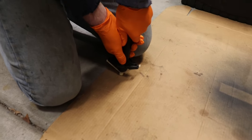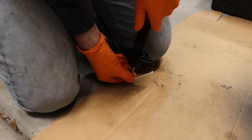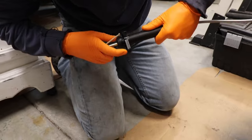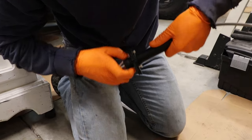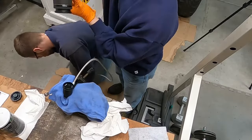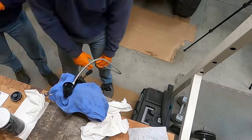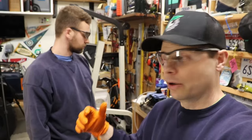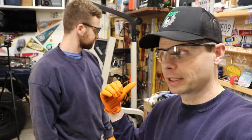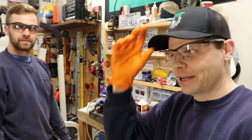So now that we're done, he's gonna go ahead and push that in and clip those nylon straps back on — just like that. This method of bleeding the clutch master cylinder — bench bleeding it — is called reverse bleeding. Go figure. So there we go: the easiest way I've found to bleed a clutch. Works really slick, things work good. Thank you guys so much for watching and have a good day.